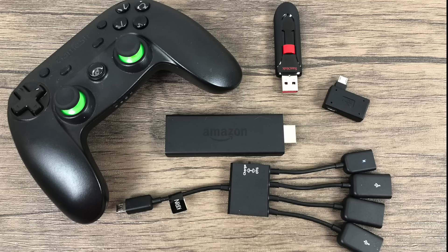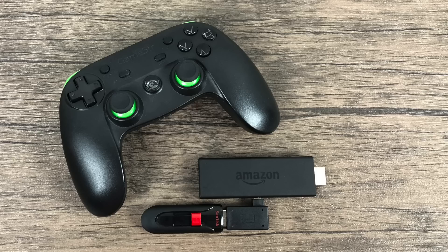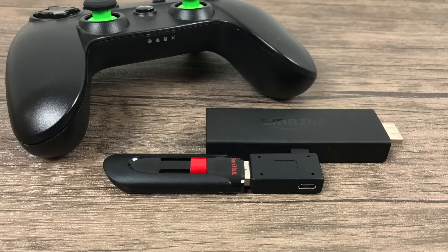The final thing you want is a USB drive — you can use USB 2.0 or USB 3.0. The highest capacity I've tested myself is a 128GB SanDisk USB 3.0 drive. You could go with an external hard drive but make sure it's powered from the wall, not from the USB port — the Fire Stick can't put out enough amperage to spin it up. My exact setup is: Fire Stick, a right-angle adapter, a 32GB USB 2.0 drive, and a GameSir G3S controller.